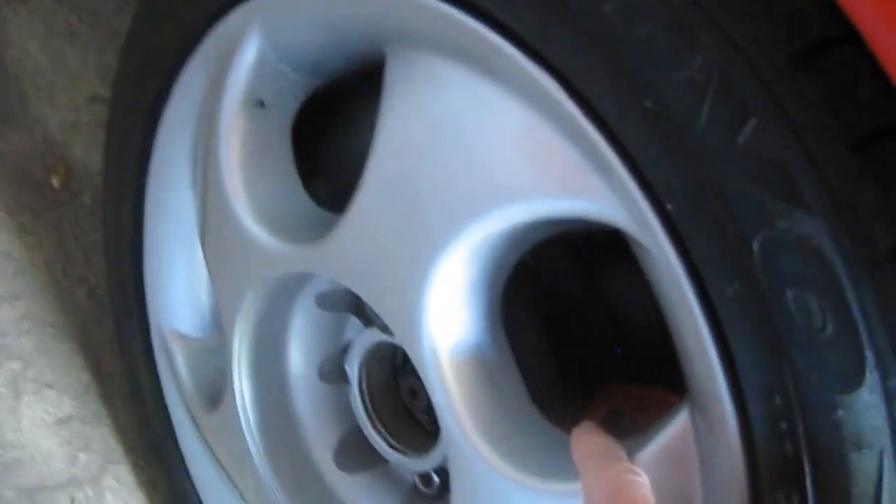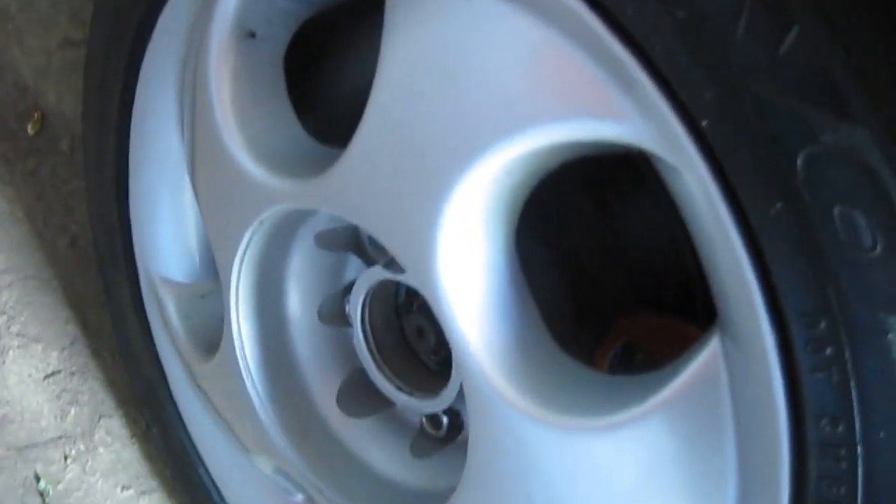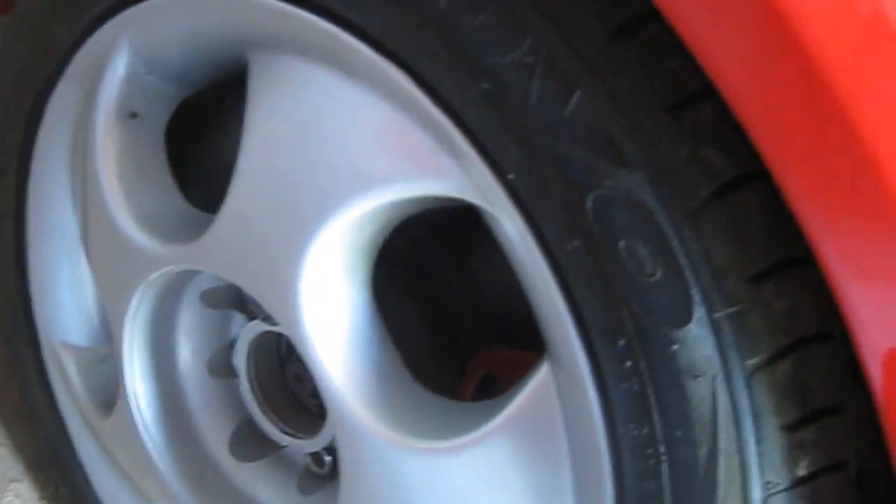While that was drying I took the Nissan out for a quick spin to buy some essential supplies, and I did notice this wheel was making noise — or this brake disc was making quite a little bit of noise and this wheel was quite warm. So I think I'm going to whip this wheel off and have a look at the caliper because it sounds like it's sticking on a little bit.